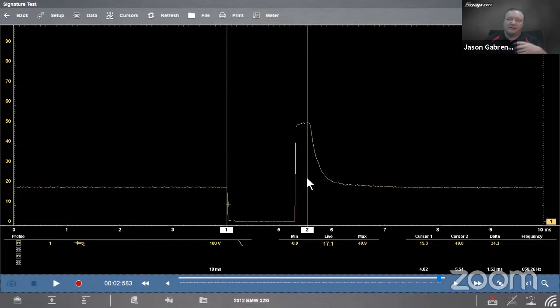It's designed for it. What you want to be concerned about, and I can't tell you what normal is either, because it has way too many variables. How much voltage is going in? How long is it being held open? How many windings are in the electromagnet? All of those things are variables for this. So say you measure all the injectors on a vehicle. Are they all pretty close? If they're all pretty close, you don't really need to worry about that part of it. If one's way higher or one's way lower, that's the one you want to look for, right? Where is my outlier? Where is my odd man out? That's where you want to look. And that's the beauty of being able to use the component tester or the scope, so I can see a picture of what's going on with my component, right?